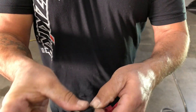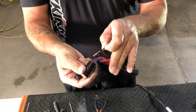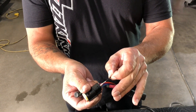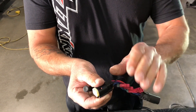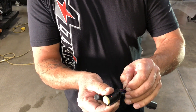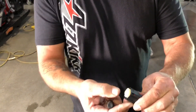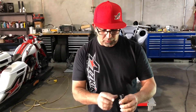You just stick it down in the hole, and as you push down, pull on the wire and the wire pulls out. Going back in — make sure you hold the wire and continue to push it straight in. If it gets in a little ways and you turn it, it will not continue to insert into the lock. So make sure you keep it straight all the way in until it latches into place. Then reinstall your secondary lock. Same principle on the other side.